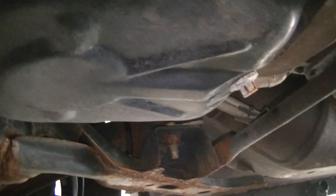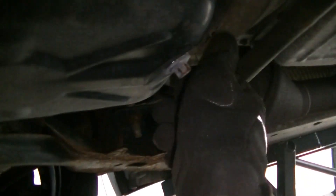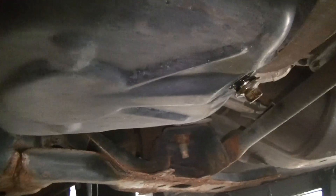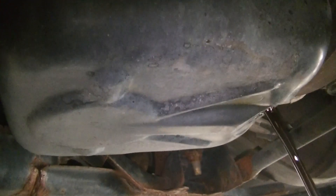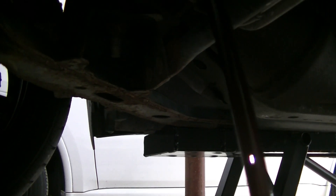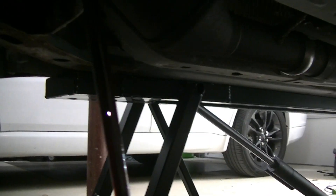13mm it is. Here we have a drain pan — I'll link one in the video description as well. Let's go ahead and try not to get too oily here because it's starting to leak. And there we go, we're going to let her drain. The oil is still pretty clean; there's not really that many miles on it. It looks like somebody put a magnetic drain plug on this too — that's pretty cool. Let's just let her drain.